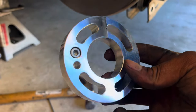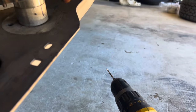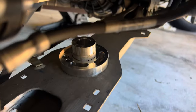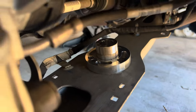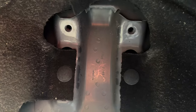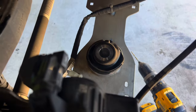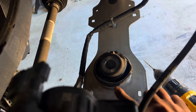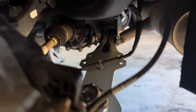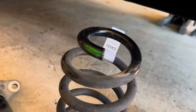You need to drill one little hole and put in an alignment dowel. Before you drill, use a Sharpie to make sure things stay aligned after, then use a center punch. You're drilling a hole through the aluminum part of the Bronco and through the aluminum spacer using a one-eighth inch drill bit. Get the bottom spacer — I used a little red Loctite on the screw — and it goes into the alignment hole. Then put the spring back in. There are two billet spacers for the shock extension with two longer supplied bolts. Don't forget to put the lower isolator back on — it's got a nipple that slips right into the bottom spacer — then the top spring isolator lines up with the spring.